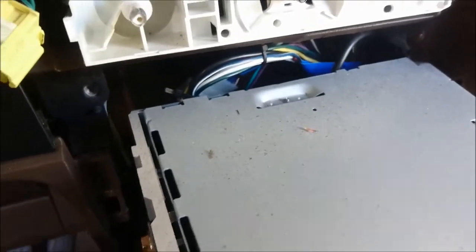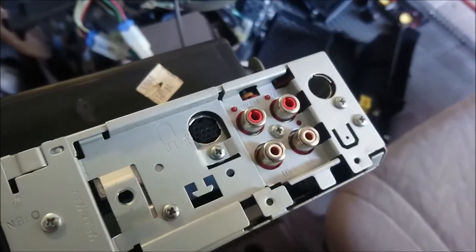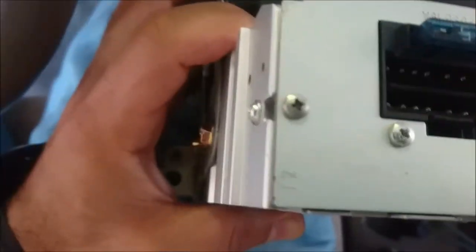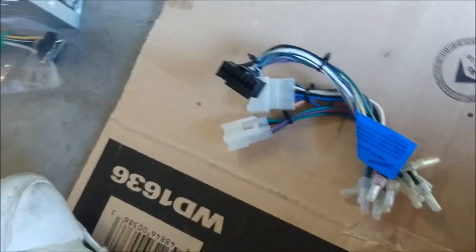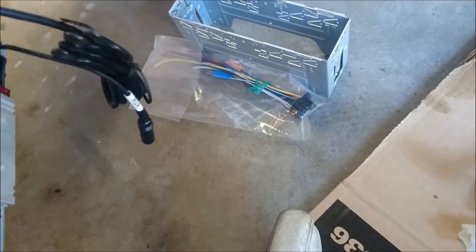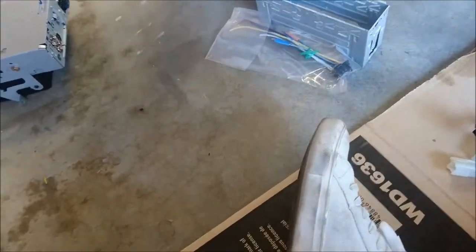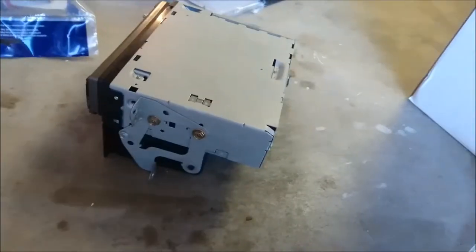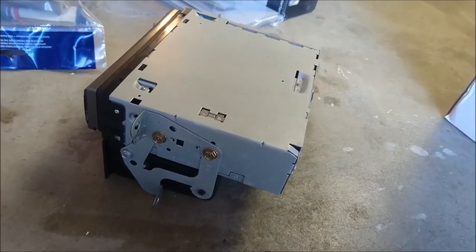So I'm going to go ahead and remove it from the back and get to the wiring part. Now we have the head unit completely removed. We've removed the iPod connection, the antenna, and the main power. We'll pack up all our wires with the supplied wiring kit to the factory wiring harness and then plug it back in. We're also going to transfer over the bracket system because we're going to use the same bracket setup as the JVC's on each side and mount it right in there.